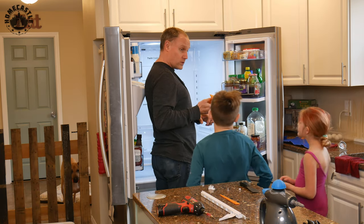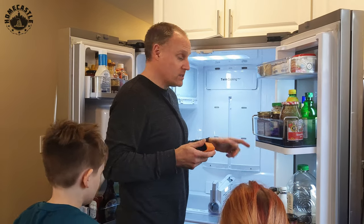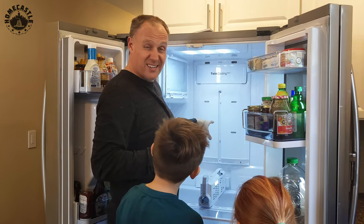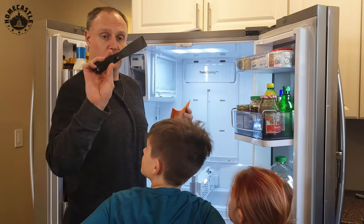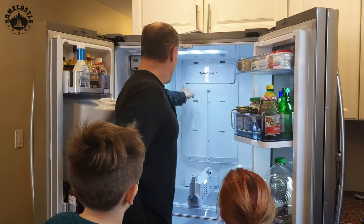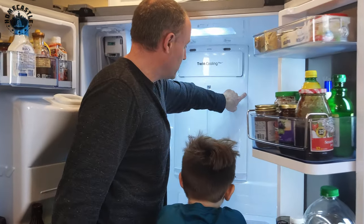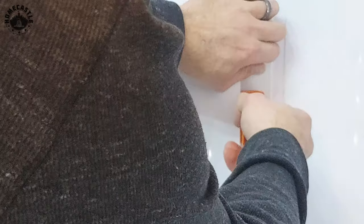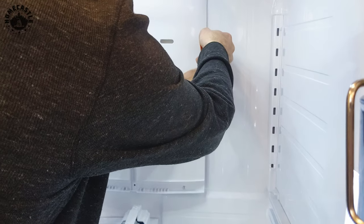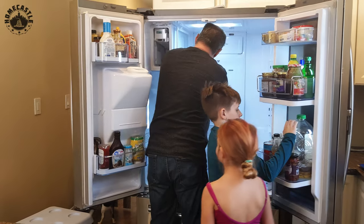So you've diagnosed with trouble codes, forced a defrost using the manual function on the front panel, removed your items and brackets, and injected steam if super frozen. Now we're going to use a panel puller — or a putty knife if you don't have one — and start at the bottom. There are little arrows on the panel everywhere there's a retainer, so pry around those arrows.